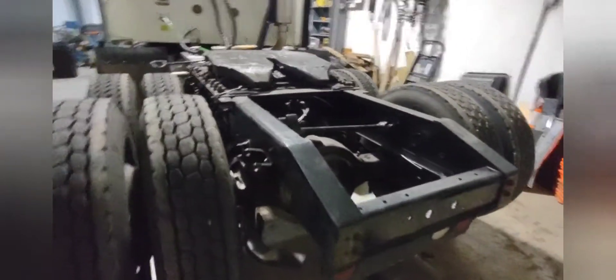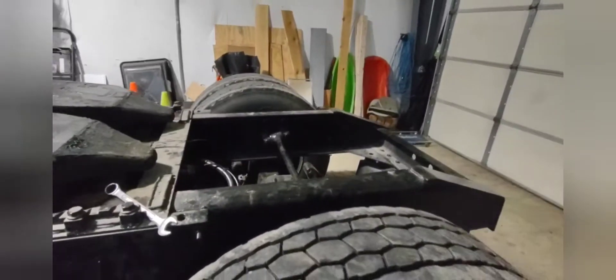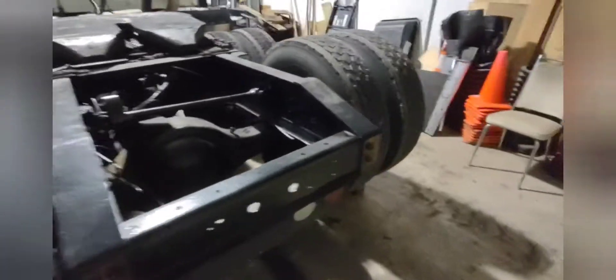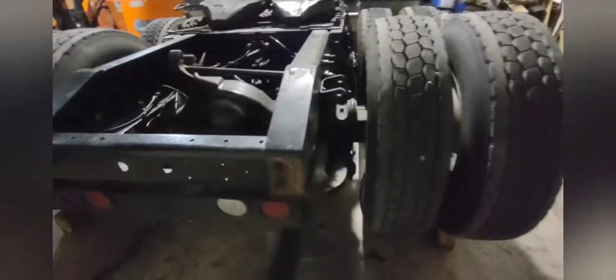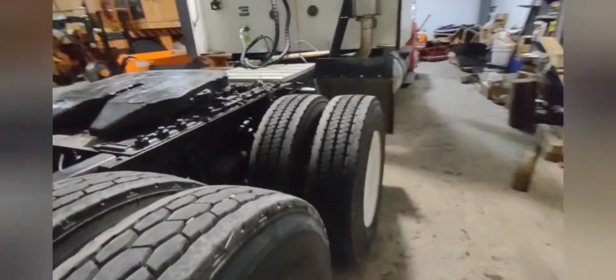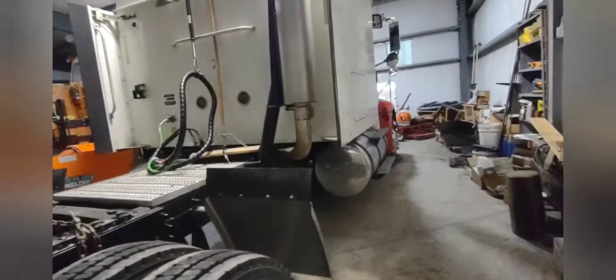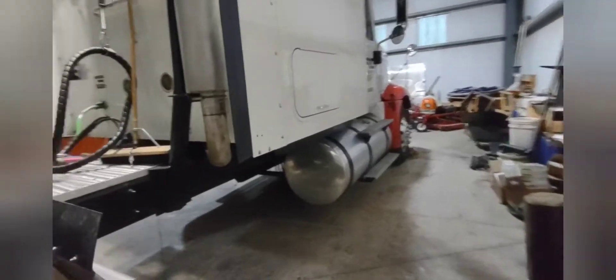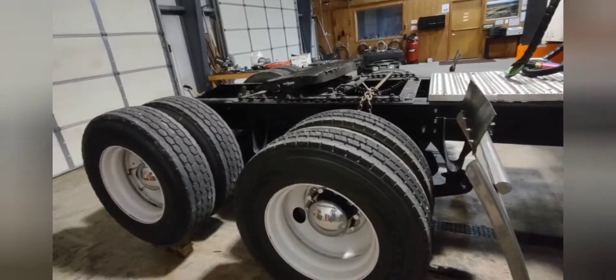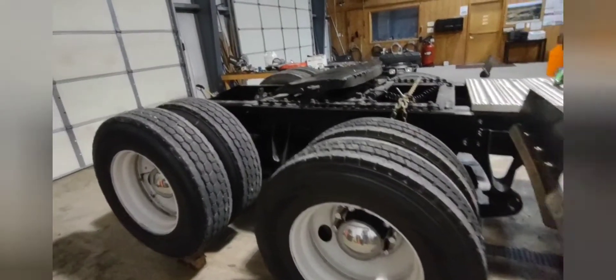The life of buying an old semi truck — how many times have you seen an axle crack on a truck, crack or wear through? Those u-bolts sure seem tight to me. I was sitting on there hammering on them with the three-quarter impact gun for a good minute and those bolts didn't move, so I'm gonna say it didn't wear through — it must have cracked. Apparently from what I hear, that's a common problem with these Internationals and some Peterbilts.